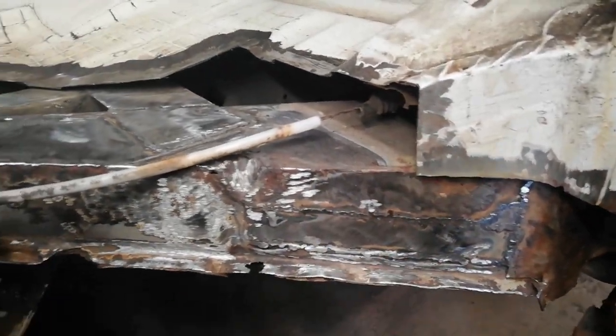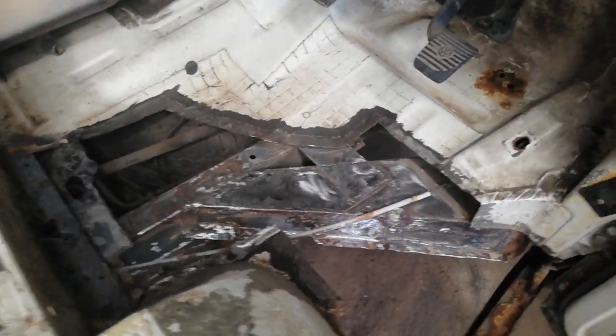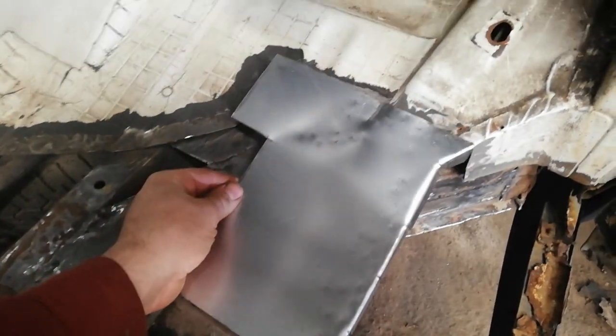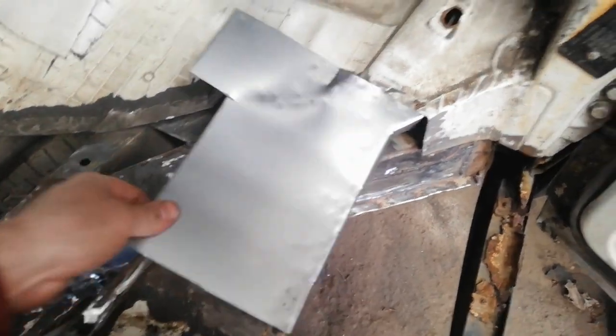So I'm going to give that a coat of phosphoric acid, and in a little while I'm going to come back out and give it a coat of paint before I start working on this. So I've just been making a section there for the floor. So I'll be carrying on with that in the next video, and back there as well. I'm going to do the same. I'll give it a coat of that stuff and then a coat of a little bit of epoxy primer. Yep, we'll leave it at that.